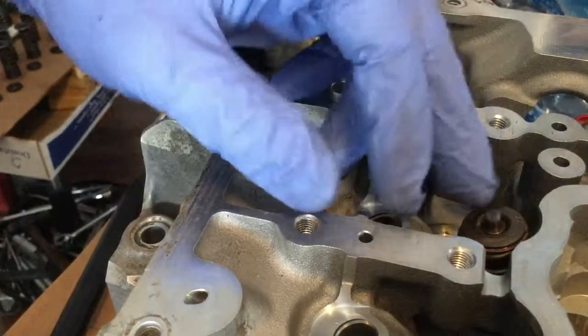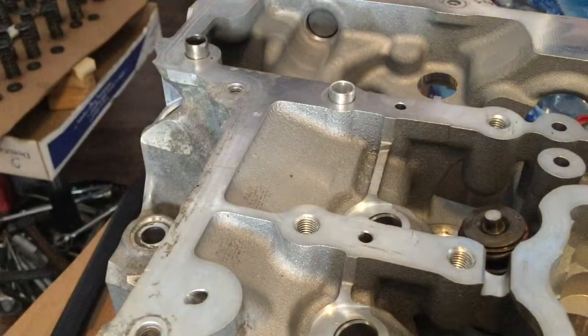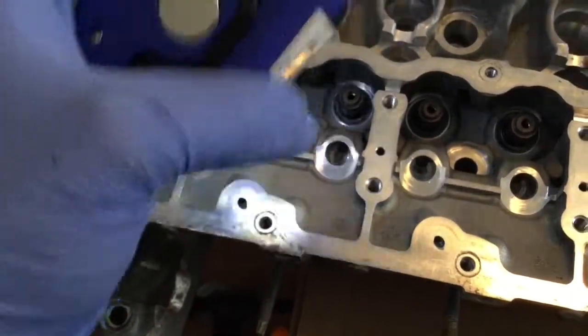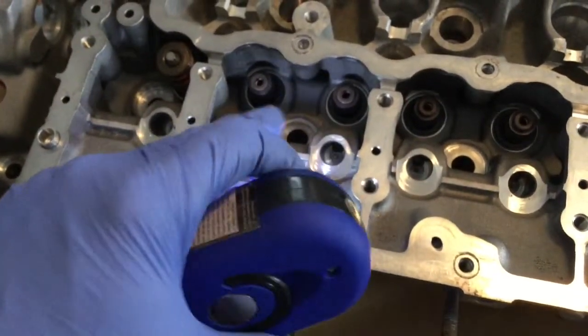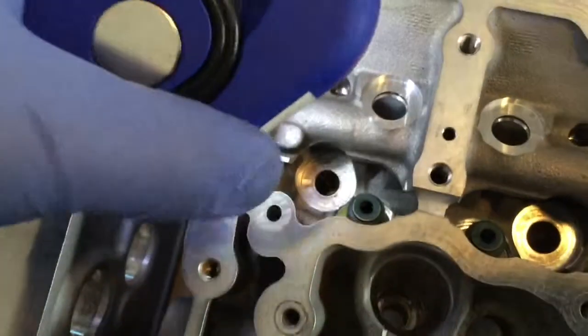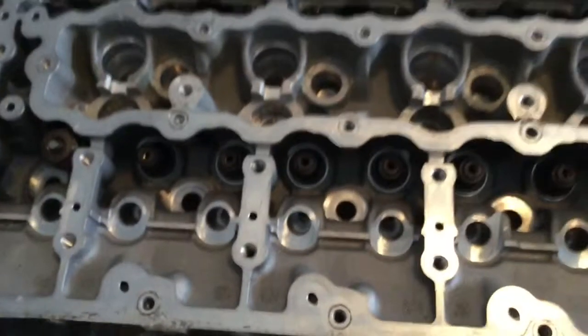Since I'm set for intake, I'm going to do the second intake valve right there, then I'm going to do the exhaust of cylinder one - first valve, second valve. Then I'm going to move the setup with the wood blocks. It's a matter of keep going and doing all of them the same way.